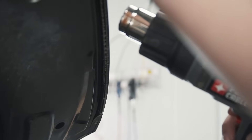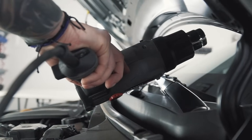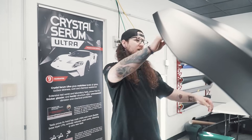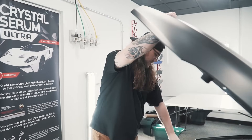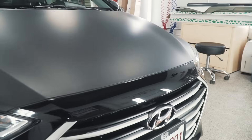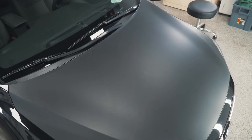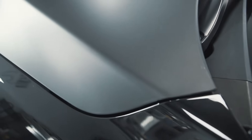Next we're going to grab our heat gun and seal all the inside edges — the heat is going to relax the film into all the edges and creases of the hood. Alright guys, hood is done — go ahead and shut this bad boy. Boom, looks great: matte black with the gloss, we're all set! Alright guys, there you have it — now you're ready to go out and wrap your own hood. Remember to drop a comment below and let us know what stuff you want to see. Hit the like, hit the subscribe — we'll see you next time.